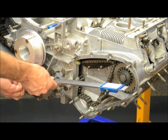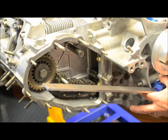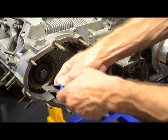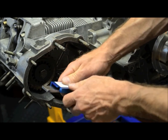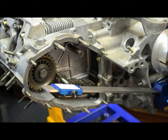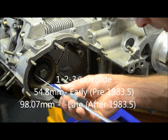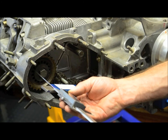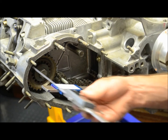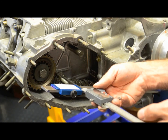To do that we have to take the block off completely as well as the caliper base. Now we're going to set up the tool to measure the 1-2-3 side — lock down the block in place with the straight edge, snap in the caliper base, and take the measurement. The 1-2-3 side should come in somewhere around 98.07. We're coming in at 98.25, 98.20, and 98.17.